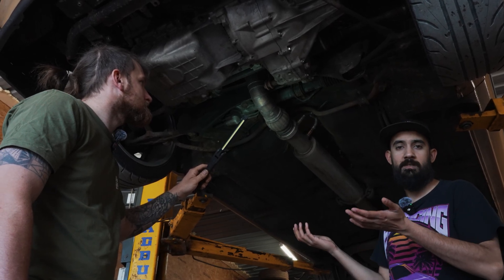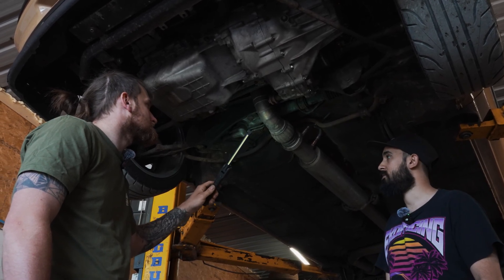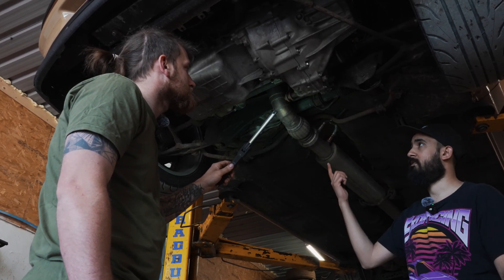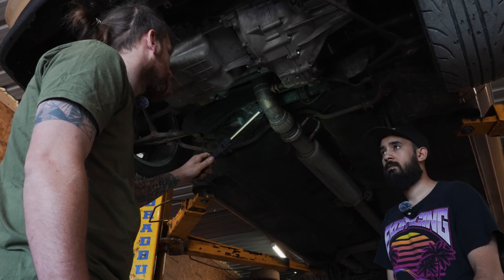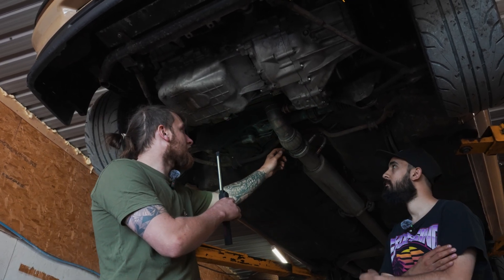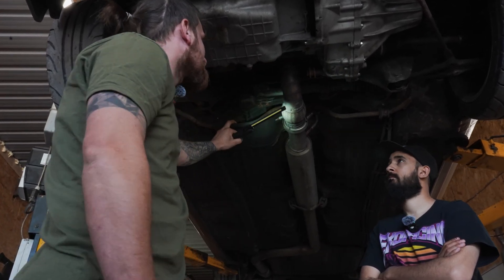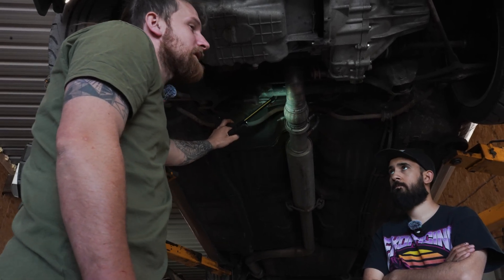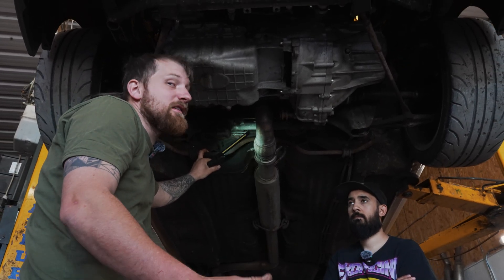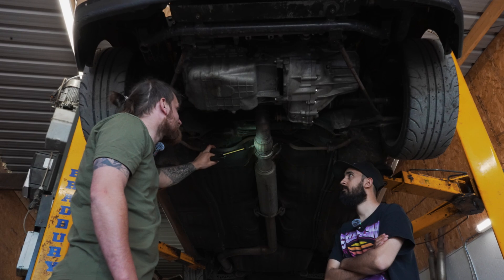Basically they're just an easier, quicker-release version of running conventional flanges, and they're not even that expensive for what they are. The self-aligning ones are a bit more expensive, but for fitting stuff like this, it's great. Scott's used them on all his turbo builds and they've never really let him down. The only thing to watch — sometimes the bolts can shear off if you're not maintaining them and you're gunning them up. Always hand-tighten them with a ratchet. Don't use a gun — we're all guilty of it. But other than that, they're bulletproof.